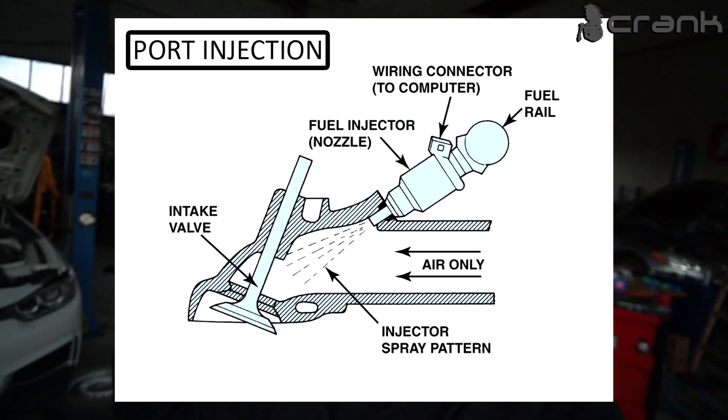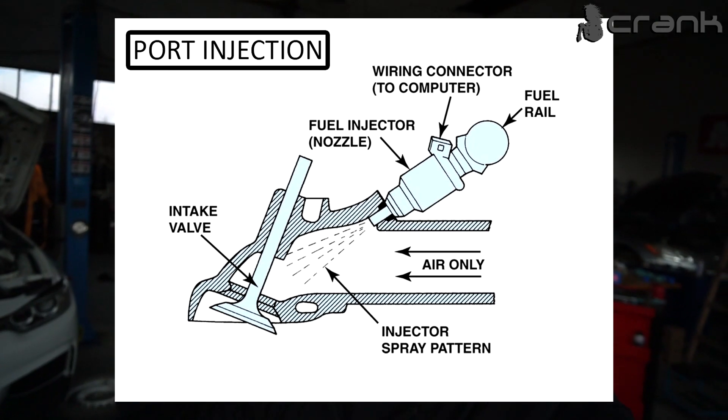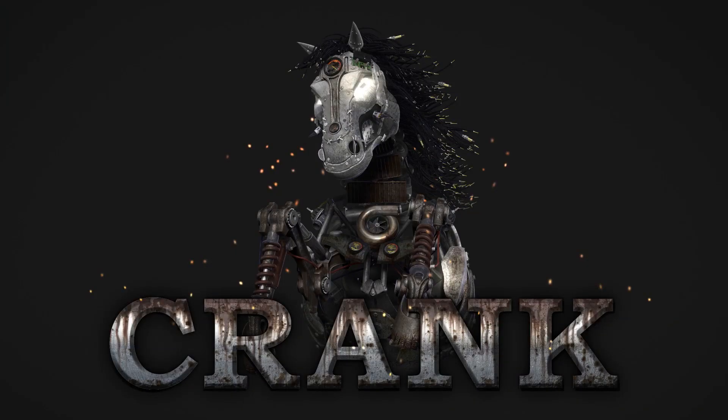The clog on the port itself and the valve stems is rarely prevented because with direct injection there is nothing to clean up your intake port. But if you have port injection, the fuel does the job — it cleans the walls of the intake port and the valve stems. About 99% of newer petrol engines are only direct injection. So check your intake ports from time to time because this can lead to issues for sure. Thank you for watching and see you in the next video.